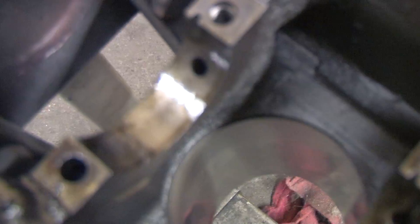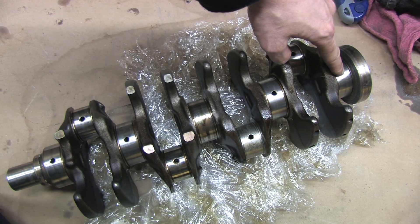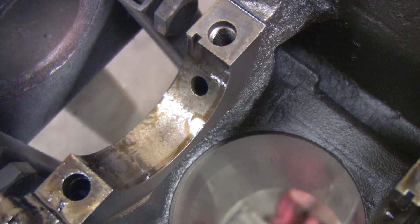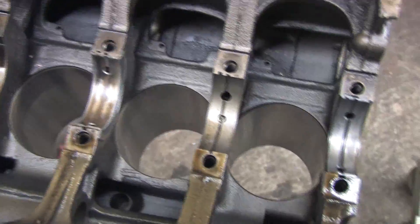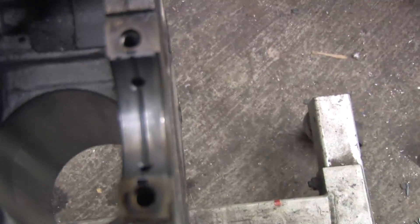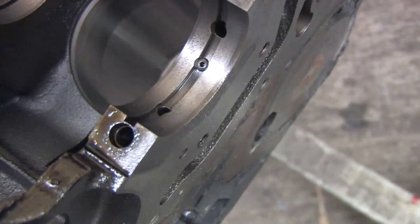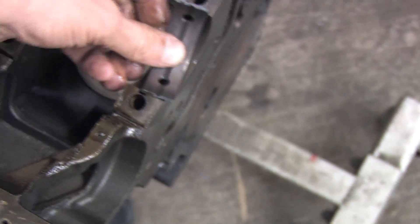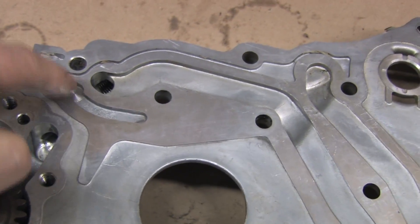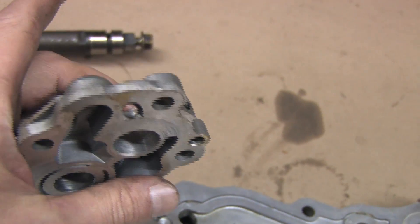One bearing doesn't have a groove to supply the second oil hole, so it naturally requires less oil flow. That's the number five main on the flywheel end of the crankshaft — this is where you want as much support as you can get because a lot happens on this side of the engine. Mitsubishi didn't feel the need for it; eliminating the groove and the oil squirter left more material on the saddle, making this main stronger than the rest. But notice the number one main — it has a second oil hole cross-drilled intersecting with a hole on the front of the block. That's an oil return hole supplied by the number one main bearing, and the oil that doesn't feed the crankshaft is returned through intersecting bores on the third and smallest groove of the front case.